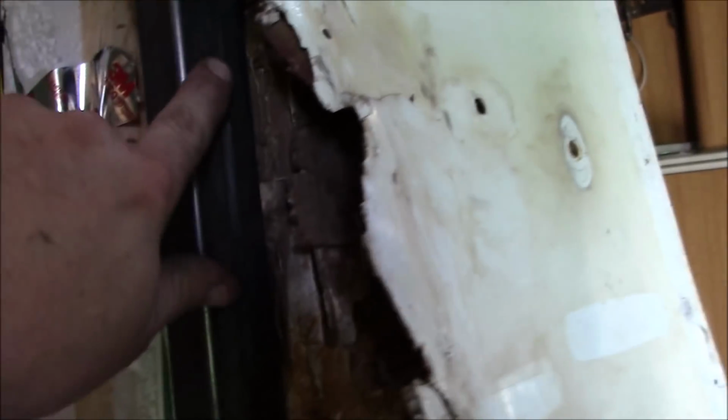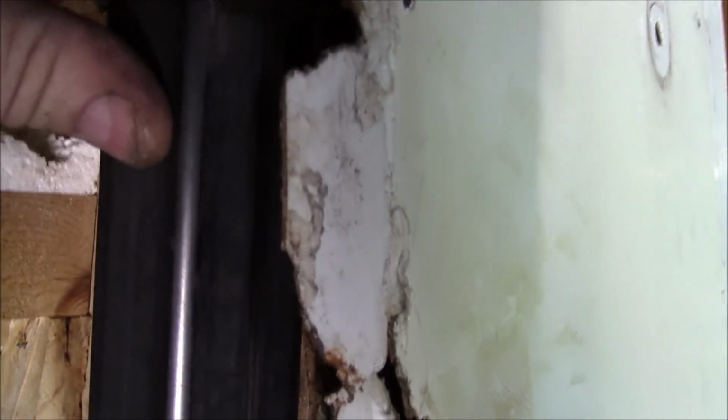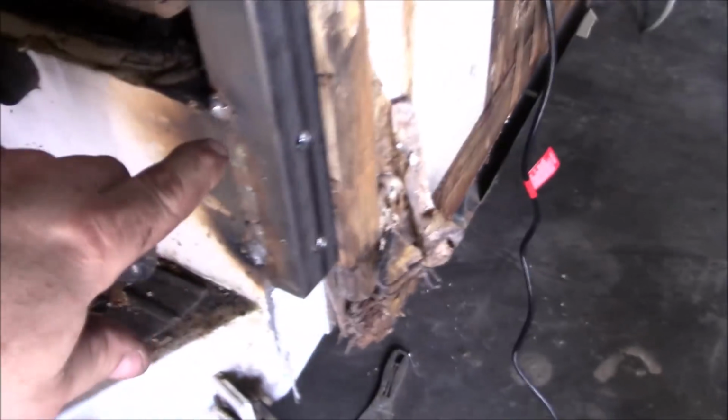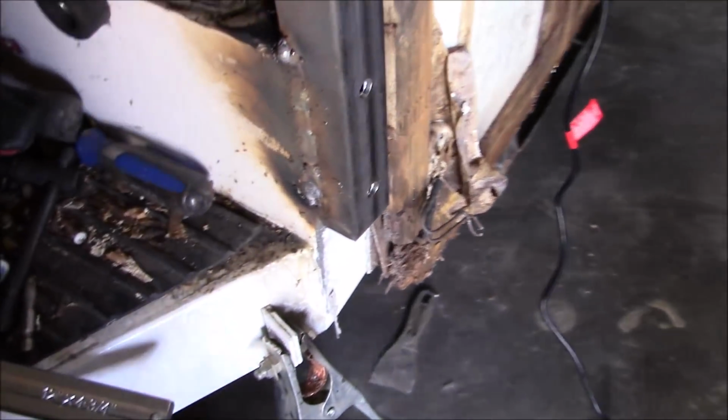But now when that piece is bolted to here and the ram jack is lifting, it's going to be pushing on this. And there's a ledge on this. There's a ledge right here, a little shelf for this to carry. We'll secure this in here. Once we get that secured in there, then when it pushes, it's pushing the whole thing, but it's also welded. Not only did I weld it, we're going to bolt it as well. This thing is not going anywhere.